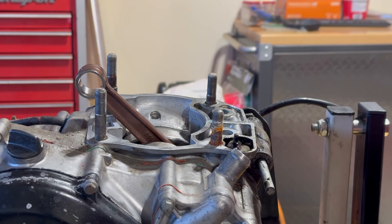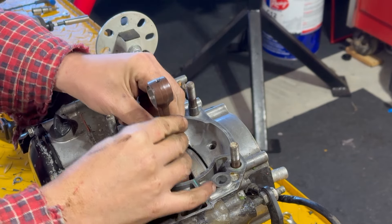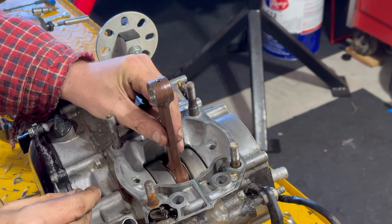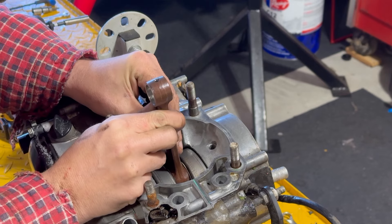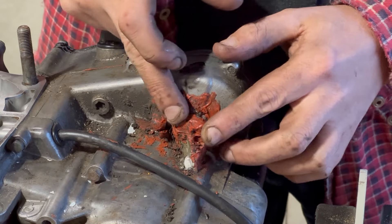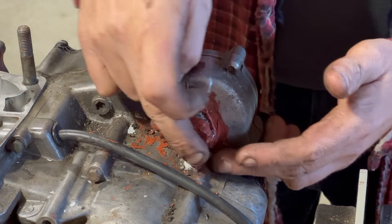That's too bad. We're going to bring our piston and rod up top. We're checking for up and down play — there's like no up and down movement. There's a little side to side movement, but no up and down movement, so that's really good. I think we're going to get a little bit of a wire wheel and try to remove some of this to see what's going on.